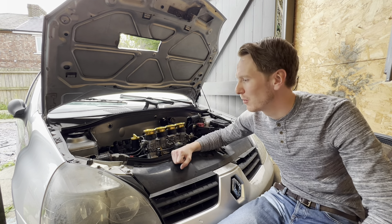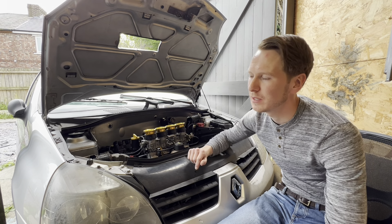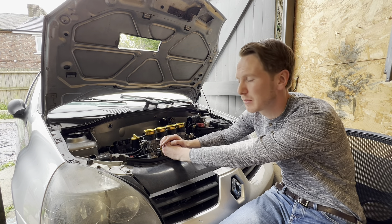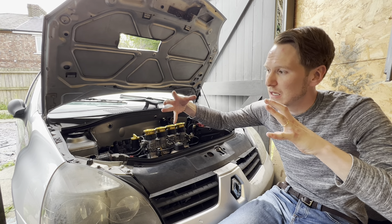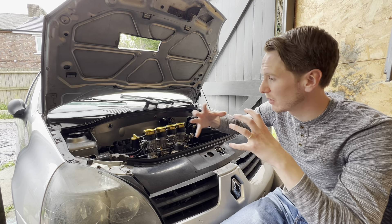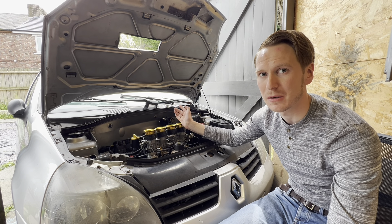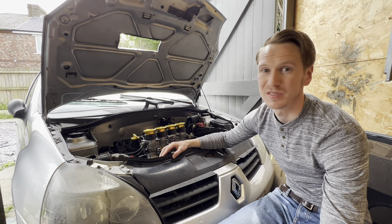What you're seeing here is an additional thing I wanted to do to fully embody keeping the combustion engine alive. The standard manifold would work on hydrogen gas, but what you have to be wary of is if you get a backfire in the air intake — you've got all this plastic air intake housing that could shatter and explode. I didn't like the idea of that. Similarly with the exhaust: I had the back box blown up on me because hydrogen gas built up inside the very restrictive exhaust. Then I had a backfire which exploded the mixed hydrogen and oxygen in the exhaust, and it couldn't escape — it just blew itself out the rear, destroying the standard back box. So there's now an aftermarket back box which is less restrictive, so if it does backfire it just shoots out like a cannon.